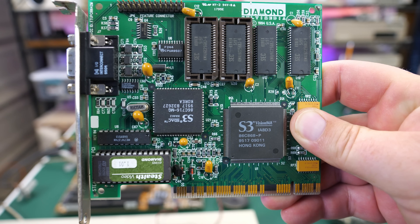I went ahead and hooked up an old keyboard, and I connected all the peripherals — the CD-ROM, floppy drive, and hard drive. Normally I wouldn't do that, but I have a good feeling those are probably working. So let's power this on and see what happens. Something's rattling — the fan is working on the processor. Nothing on the screen at first — not even the hard drive spinning — because I didn't hook up the power to the drives. I hooked up the floppy and IDE cables but didn't actually hook up the power connectors.